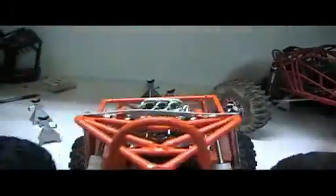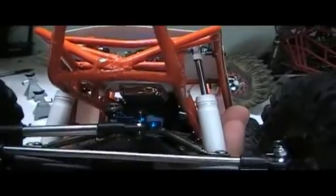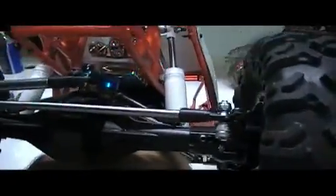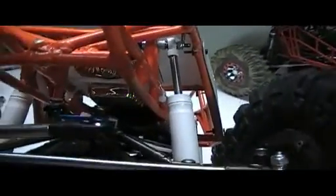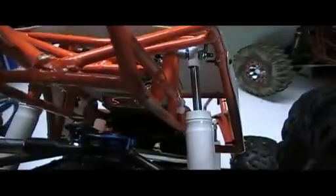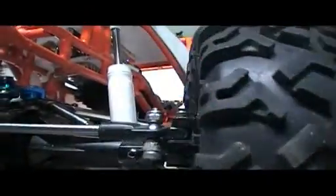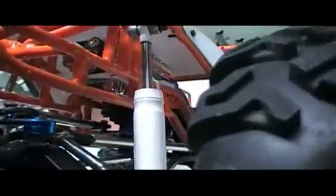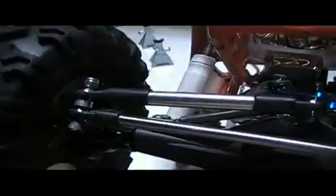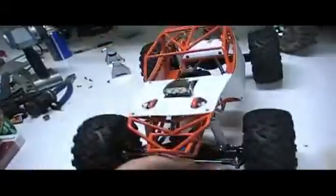And up front we've got a cantilever steering system on it, which is very interesting. The cantilever makes it to where your servo is chassis mounted. It's behind that fake motor back there, but you've got your servo with an aluminum horn on it back there, connected to a rod which comes up to this turnbuckle, which in turn goes to your drag link down to the steering assembly, and there you go, you got steering.